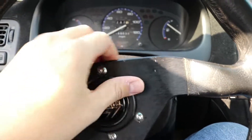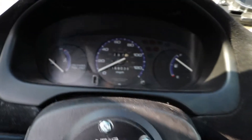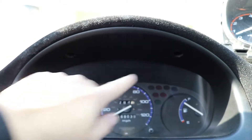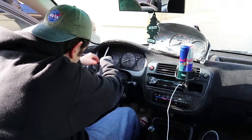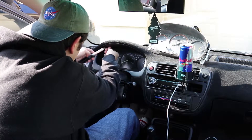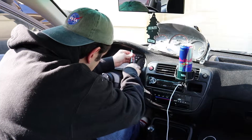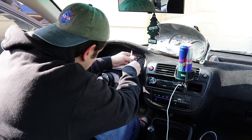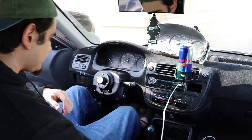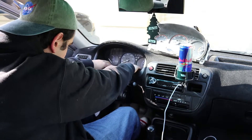Let me just remove the quick release steering wheel so you can have better access. You're going to have to take these two screws up here — lighting's not too great — this screw up here and this screw, and they're both Phillips head screws. So let me do that right now. And what you're going to want to do is pull on this thing — there's two clips so you kind of got to do it hard. Pull down and back, it should pop right out.